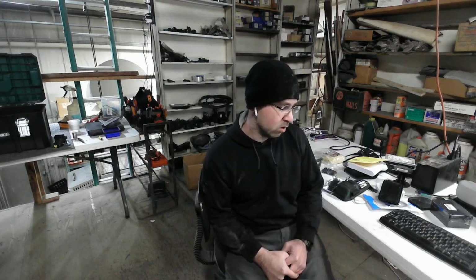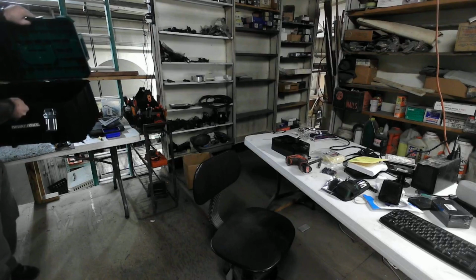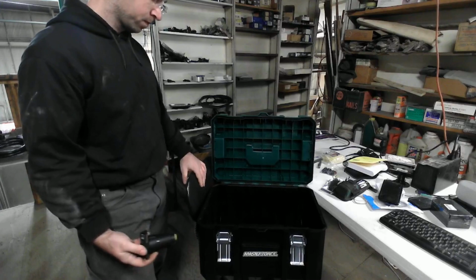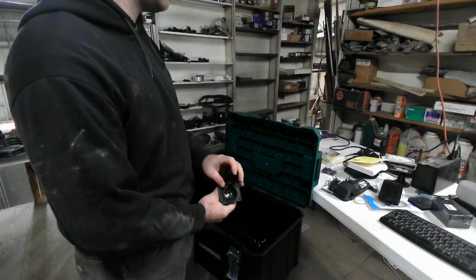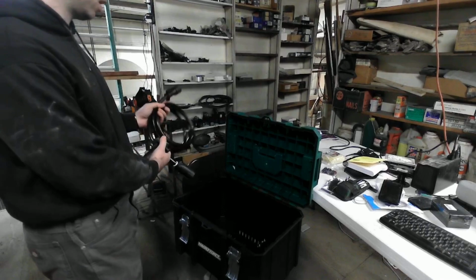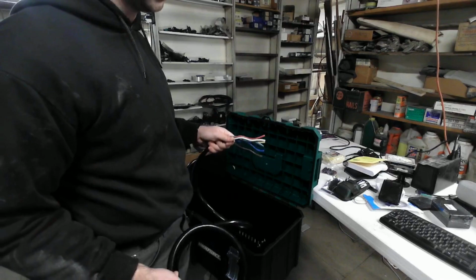And so in the lab we have the box. Here is the box. The box is going to have a trailer port on the side, a trailer port on the other side as well, and one of the sides will be for the truck, the other side will be for the trailer. So how will you plug the truck in to a female port? Well, you'll use this jumper cable here. It'll go from the truck to the box. Another option that you will have is from a 12 volt battery, which you can bring with you wherever you're doing your testing, to the box.